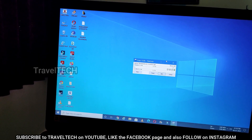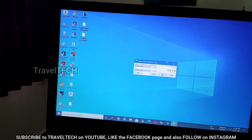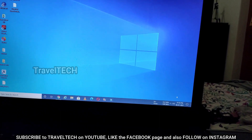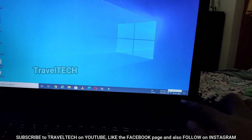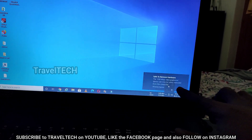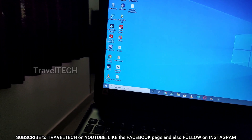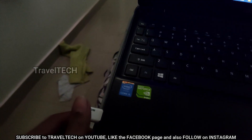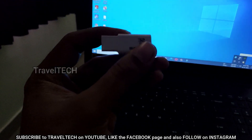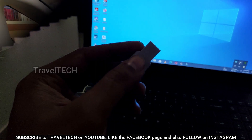Once the app is copied to the pen drive, remove it and go install on the Digipad. Wait for copying to complete. Once done, head to the taskbar and click the 'Eject Media Storage' button before removing the pen drive — skipping this can corrupt the file and cause a parsing error. Once properly ejected, remove the pen drive from your laptop. Now I'll show you how to insert it into the Digipad's USB socket and install the app.